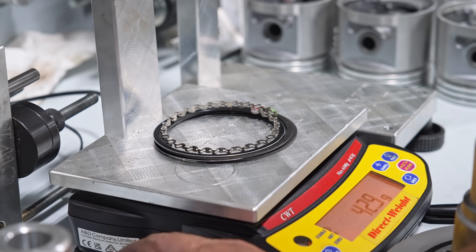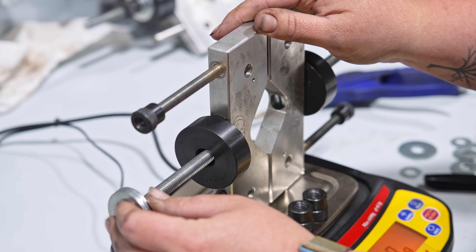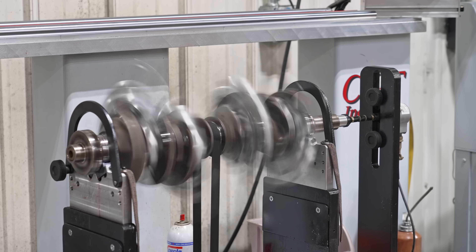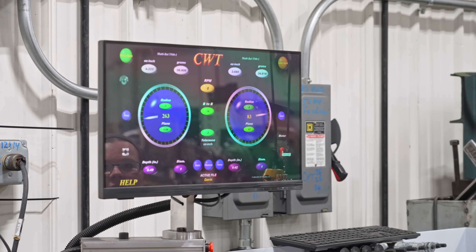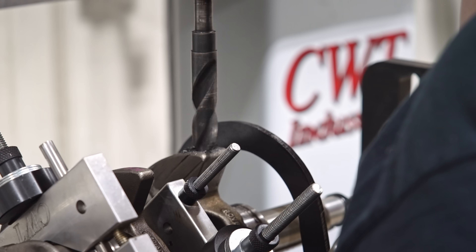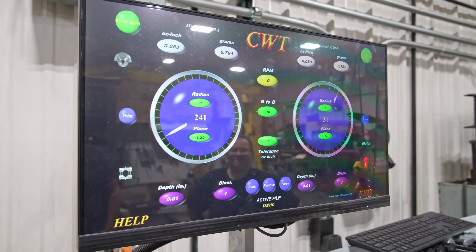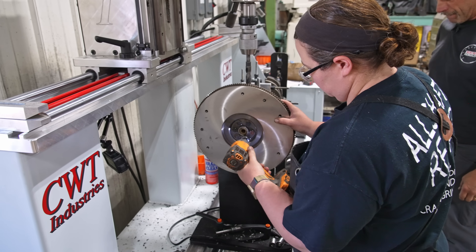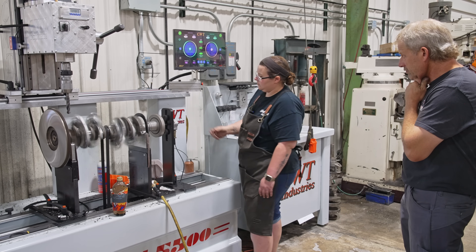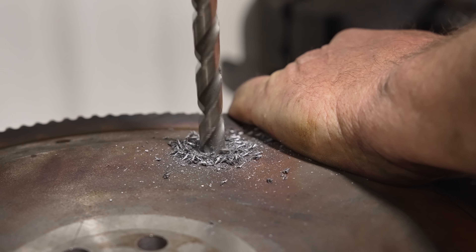In addition to that, we need the weight of our rings and the weight of the bearings to be used — we add all that up and that establishes what's called the bob weight. That is the weight attached to the throws on the crankshaft. The assembly goes into the machine, the machine spins it and determines where weight needs to be added or removed. In our case, we need to remove material, which is a simple process of drilling holes into the counterweights at the prescribed angle. You want to sneak up on things because adding weight is more complicated — take your time and get to zero balance. Our last step is to zero-balance the flywheel and the balancer. Even though these are internally balanced components already, it's always a good idea to verify that. Both parts were slightly out of balance, so we removed a little more material at the prescribed angle. Now we have a balanced rotating assembly.